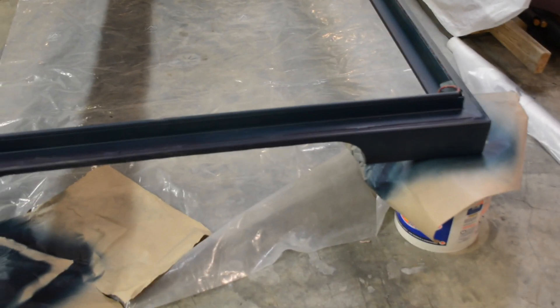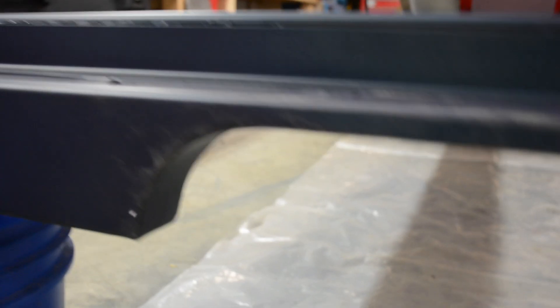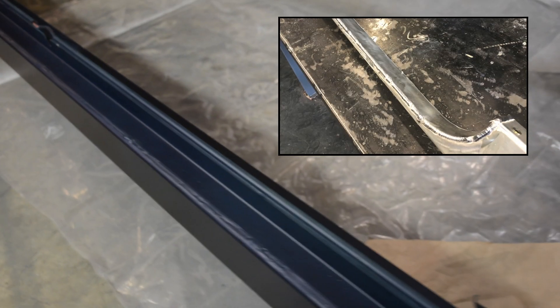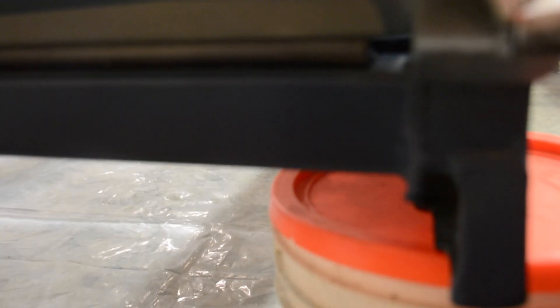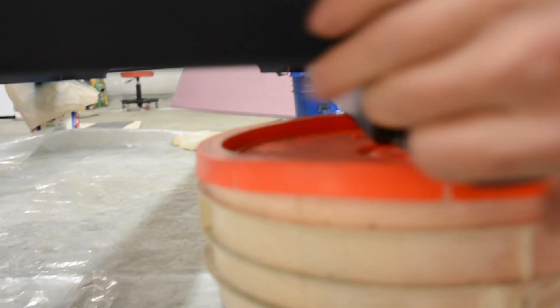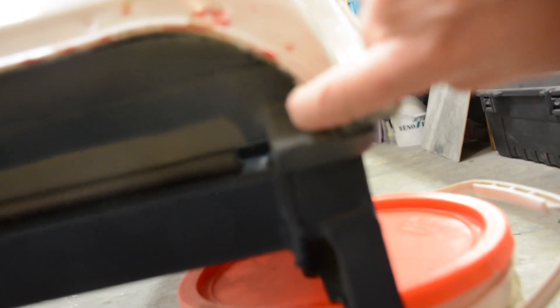I'll insert some pictures during the process of welding and closing up that section. You end up with a full length of 4 by 2 going all the way along the side of the car. In the front, there is another 4 by 2, but this time oriented on the horizontal side — again because the windscreen frame protrudes into the roof, so we have to replicate that curve in the frame.